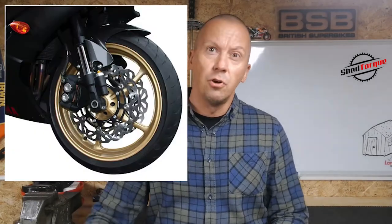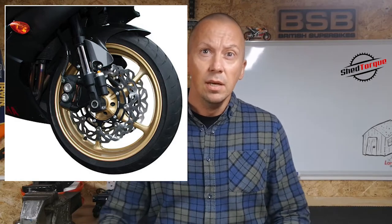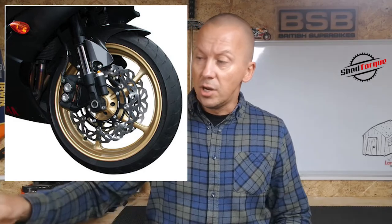The more aggressive pads, the ones with the higher mu, the higher coefficient of friction, those compounds can increase your rotor wear unless you've upgraded your rotors and got some stainless steel, hardened rotors. I've got Armstrong stainless steel induction hardened wavy discs. They're about £100 each. Induction hardening is basically a form of heat treatment